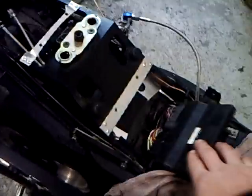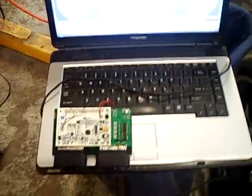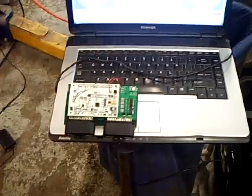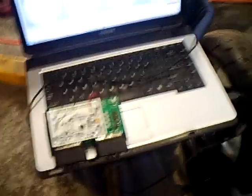This is my newest board. This is an interface PNP for 05/06 GSXR1000. This one has a turbo on it and still has the stock ECU. This board will plug in place of the stock ECU. It uses all the stock crank and cam sensors, temperature sensors. We do change the intake air temperature sensor, but that's it — it can use the stock one, but we change it for the turbo bikes to an open element GM style.